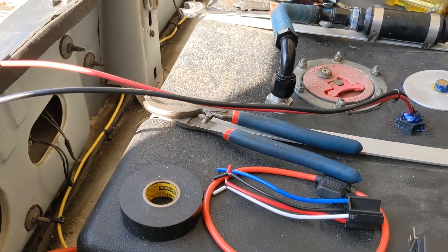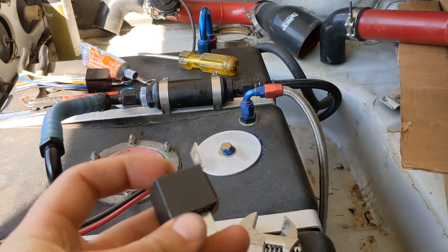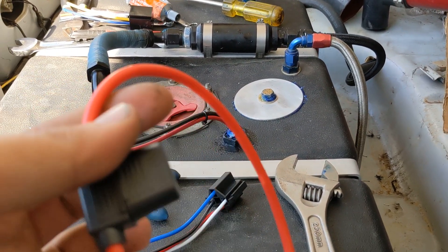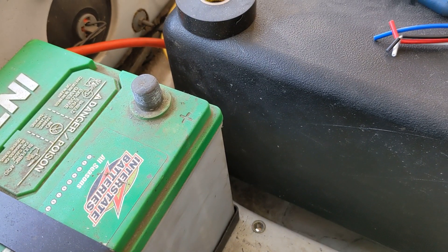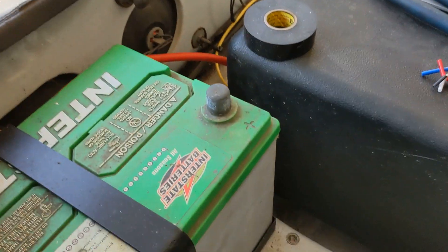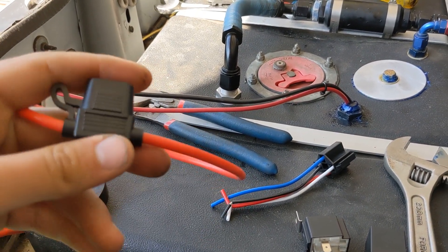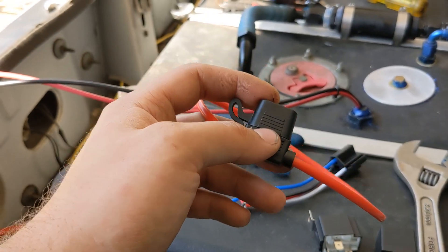Back to the fuel pump — we do a very similar thing. We run these big heavy 70-amp fuel pump relays, and since you can't get heavy-duty fuel pump relays with an internal fuse, we run an external fuse like this with good heavy-gauge wire. We run that directly to the battery or your kill switch. We do that because we don't want voltage drop — we want it coming directly off the battery to get the best supply possible, because if you don't give your fuel pump good enough voltage it won't flow as much and you'll run out of fuel much sooner.